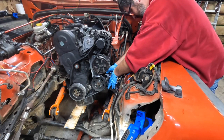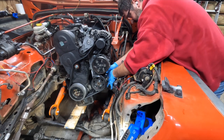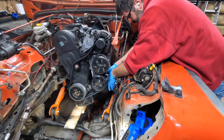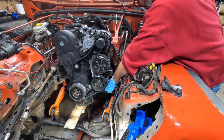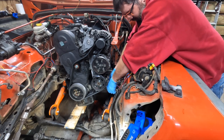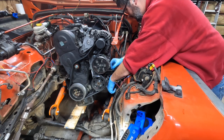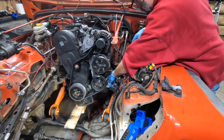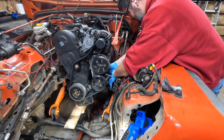It's just really tight over here. I think I know how I'm going to do this now. I'm going to go ahead and tack these base plates just to the two frame mount perches and double-check everything. I'm going to do this very slow and methodically to make sure everything works, because this piece I'm also going to have to trim a little bit to go around the dipstick.